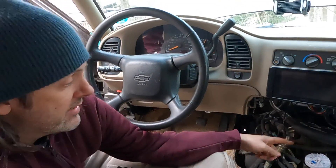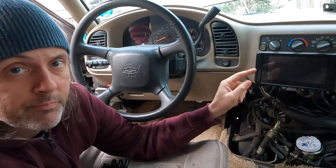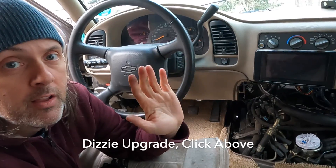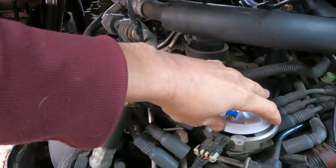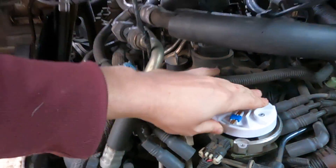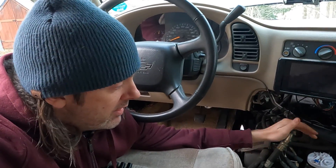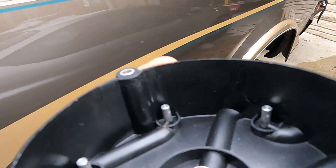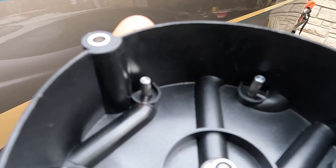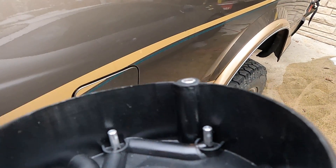Before we get started, you're going to want to verify that your distributor is in good shape. This is a pretty much brand new distributor — I have about 5,000 miles on it. If you want to see a video on how to replace your distributor with a higher quality billet unit, please click up here. What I want to show you is on the distributor cap: when you look at all the contacts, instead of the rotor firing where it's closest to the center, it's firing off to the side.